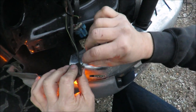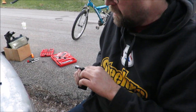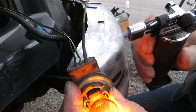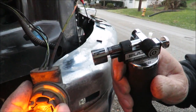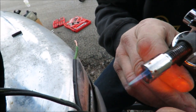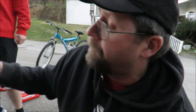I'm covering that bare spot up right there. You can see it's shrunk down - see how it shrunk down so it's tighter than any electrical tape will ever get. Got it hot enough - smearing the solder around so it totally covers the connection.